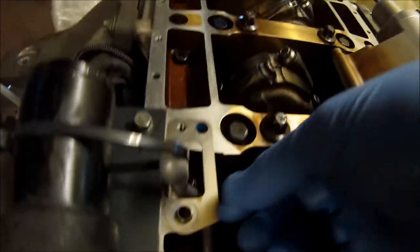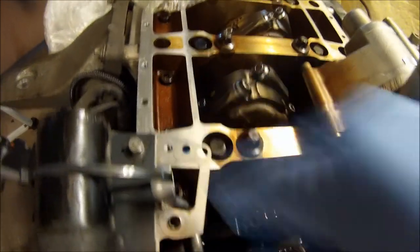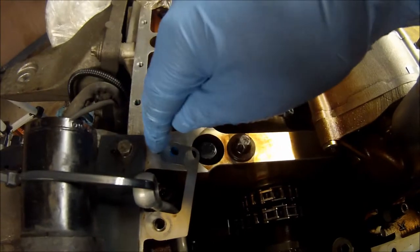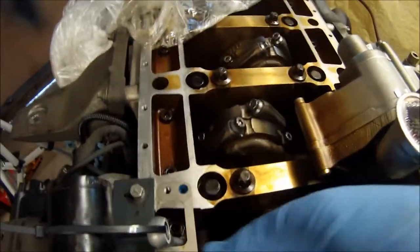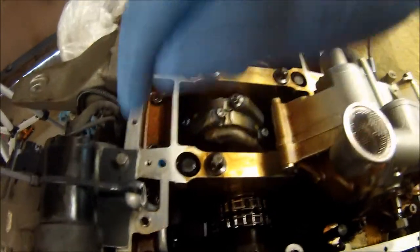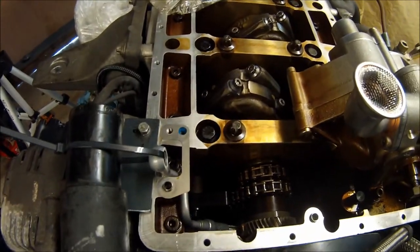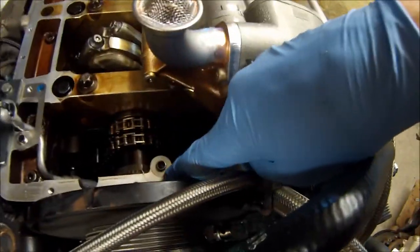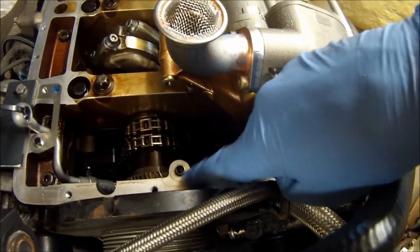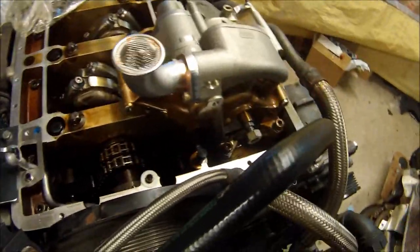If you don't hold the Vanos line back out of the way, it could pull the shim over and you might not know - because the bolt would still go in. So the idea is to hold the Vanos line out of the way so you can get the shim in the right place and align the bolt straight through into the thread. You've got shim on there which spaces it up. I've already changed the piston as we did earlier, so we'll look at getting the pump in now.